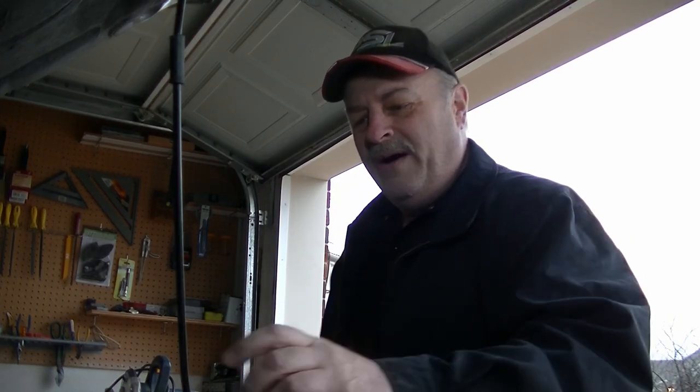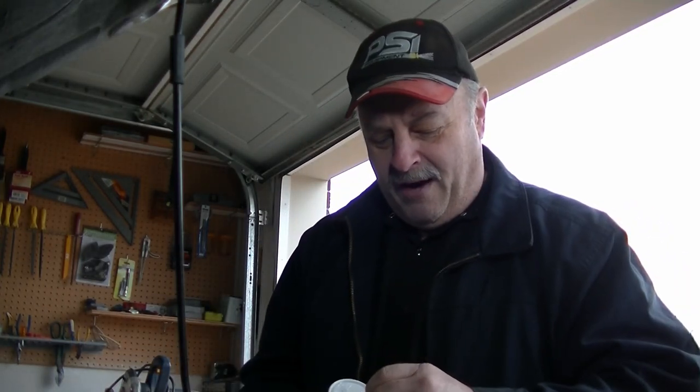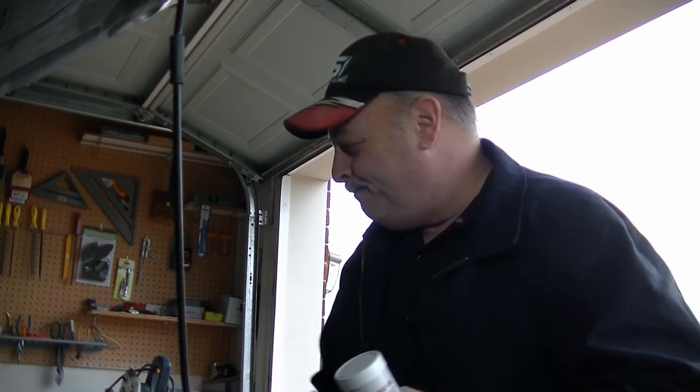Anyway, I wanted to give a call out to those guys because it was Eric, the car guy, who had this one video where he was replacing a bolt that was threaded out in an oil pan. I forgot what vehicle it was. I'm not going to go replay it. He says, hey, you still got half your threads? Well, go down to the hardware store and get yourself a longer bolt, cut it, taper the end of it, and you're golden. He was dealing with a 14 millimeter by 1.5 pitch.